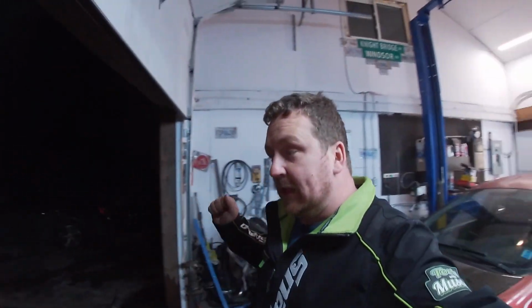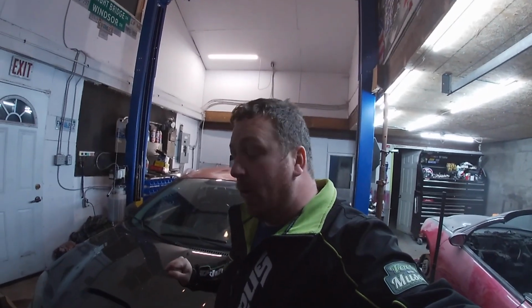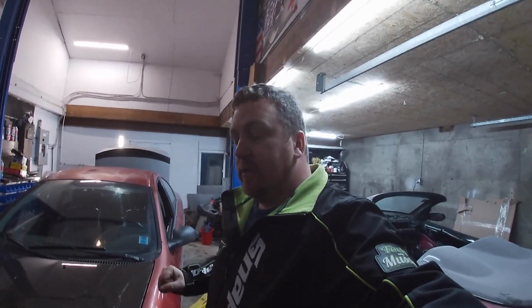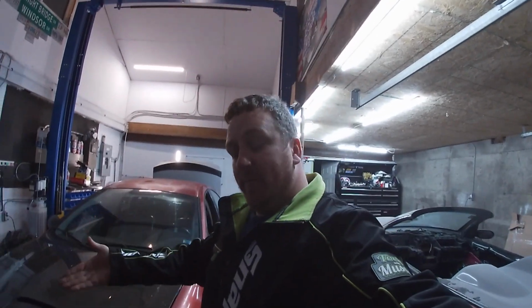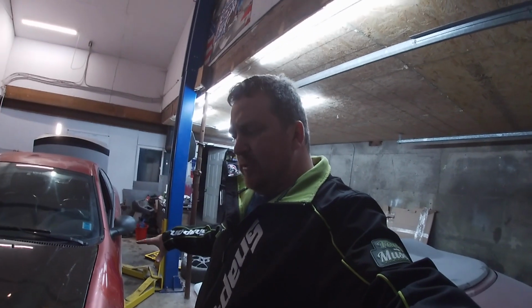So today, if you followed along with the PT Cruiser, we did a free lowering kit. Actually rides really nicely. And if you're familiar with the SX 2.0s, then you know what we're about to do. We are going to use first gen springs on our struts. I had an ACR, so I gave Jeff my ACR springs that were sitting around. It should drop it 1.5 inches, 2 inches.